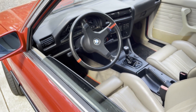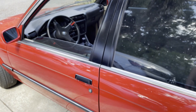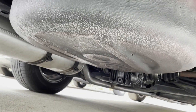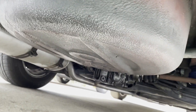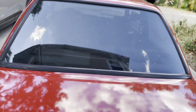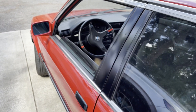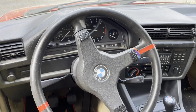After working for about three months it just said nope, done working again. So we're going to see what we need to do. On this particular car, like a lot of the others, the speed sensor is back on the rear diff. We're going to crawl in there, pull that thing out, look at it, check the connections, and see if we can get the speedometer working so we know how fast we're going.